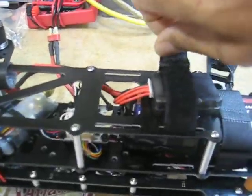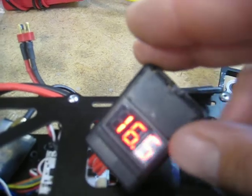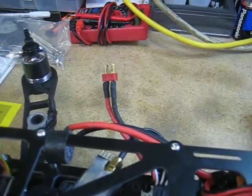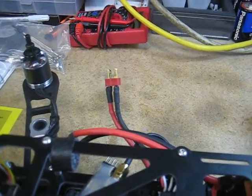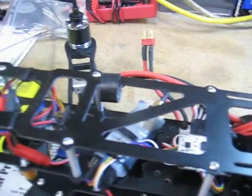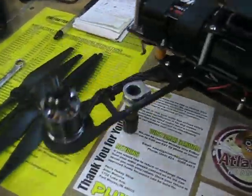As for how I'm going to know my battery level — I'm not going to fly it too far. I bought this little voltage indicator, so it tells me each cell's voltage, and I can set it — I've got it at 3.5 volts per cell right now and it'll start going off. I'm going to see where we're at as far as milliamp use at 3.5. Maybe I might be able to go down to 3.4 and get more flight time out of it.